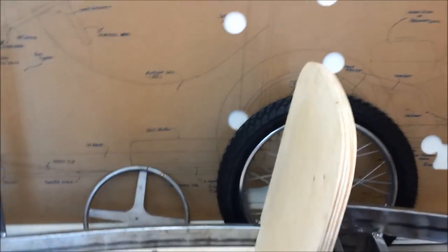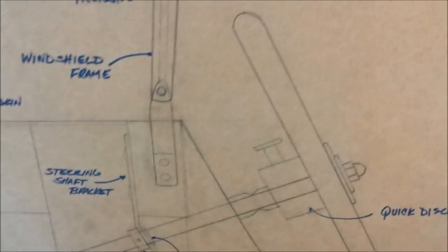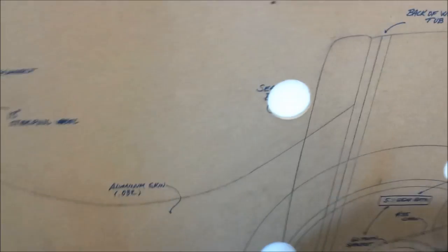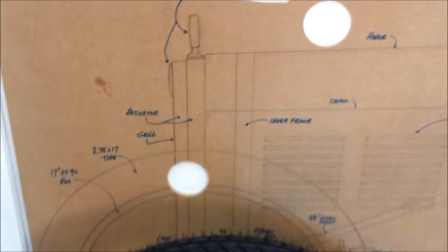I changed the seat back angle a little bit. One critical measurement is from the face of the dash to the back of the seat — I want 27 inches, but that was clear back too far, so I changed the angle a little bit to get a little more clearance to get in and out. Here you can see where the cowl support lines up with the cowl support in the drawing. Also of note is that this isn't the actual front of the car — that's a sub structure. The finished car is four or five inches further out, covering all this — it will be out to about here. When you add the radiator and then the tail section, it all comes into scale and starts looking like the real thing.